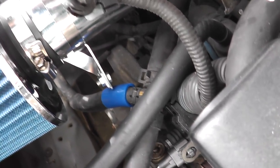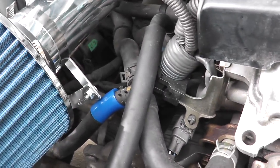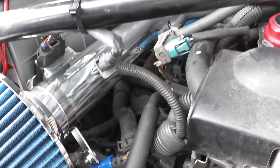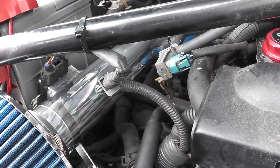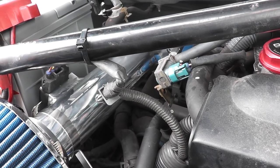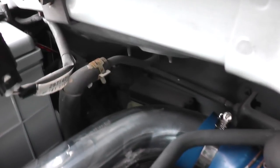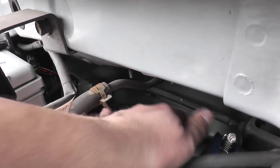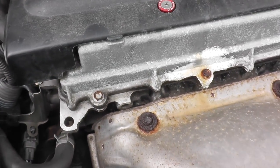It was a fairly simple install. I will do a sound video showing how it changes the exhaust note — it's pretty normal up to about two and a half thousand revs, and then if you really give it some over that it starts giving you some noise, sounds a little bit more like a sports car. Normally, down the back here where there's fair space, that's the most advantageous spot for mounting a filter because it's well away from the heat sources of the manifold and the exhaust.